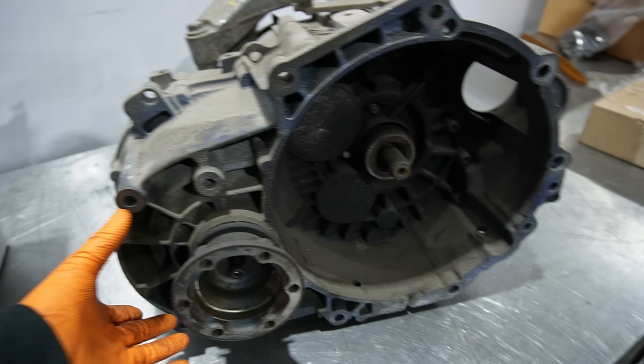We've got some new parts that showed up today. One is to strengthen the input shaft — this bar fits in there and we're going to weld that up, which is going to prevent this from flexing. We also have this piece that's going to go on the outside of the case; it has some fancy bits and actually rides along this to again prevent flexing.